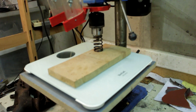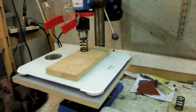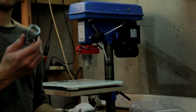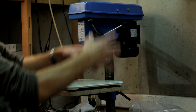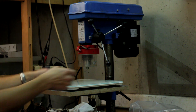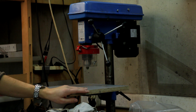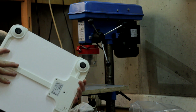I don't have a valve spring tester, but this is what I came up with. This is my drill press and my bathroom scales, and it works quite well. I'll show you the process of how I'm measuring the valve spring pressures. It's quite easy — you only need something to put the force down and something to measure it. I have this drill press which has a small metal table, and I put a piece of wood on there to mount my bathroom scales.